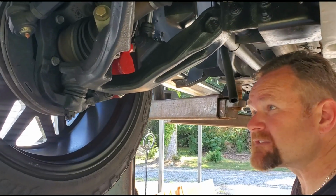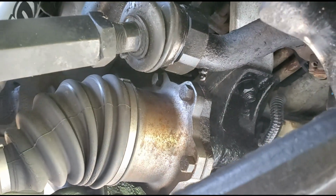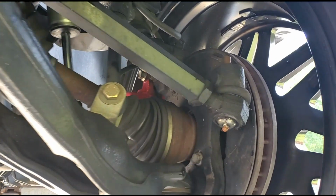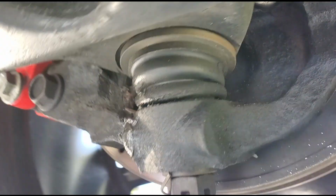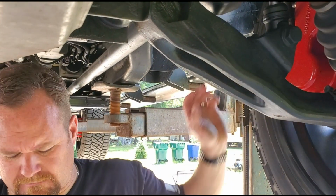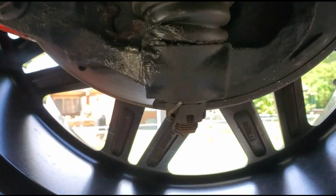So we're going to do our lube points. Got one here, one here, here, here, on the tie rods, lower ball joints. These are the ones where you're going to need to turn the tire to clear the caliper out of the way so you can get your grease gun in there to lock onto the nipple. Couple pumps. See it move and go up, so that's good.